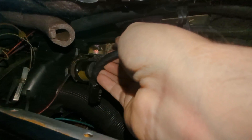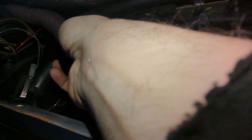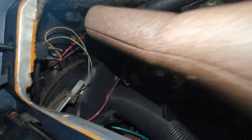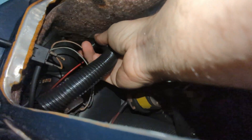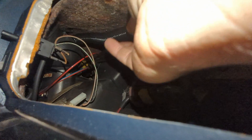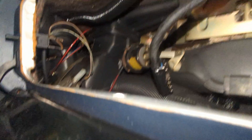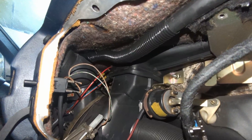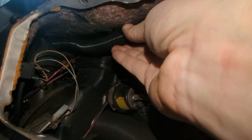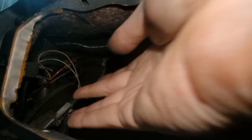While you're back in here putting this temperature regulator box back in, you should check out the state of your tube for the automatic sensor. Someone has put some pipe plumbing stuff on there — the split loom has a snug fit and fits on there really nicely. We'll move our air past that temperature sensor to make sure we're getting a perfect, non-binary, linear temperature regulation of our climate control system. Now let's put our climate control box back in, plug it in, pull the car out of the shop, and see how this thing works.